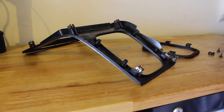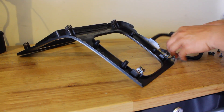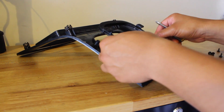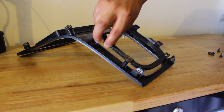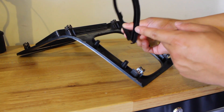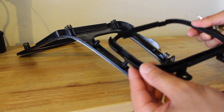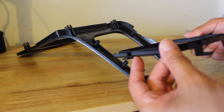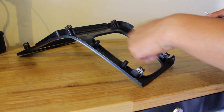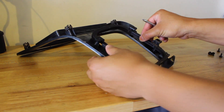If your mounting points are functional, here's how easy it is to mount the shift boot retainer ring. Here are the screws. First, make sure you get the orientation correct — there's only one way to put it on. There's a little divot or cutout on the piece. You're going to put that cutout towards the back or rear of the center console radio bezel.